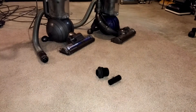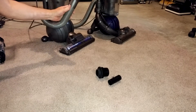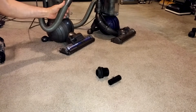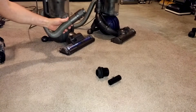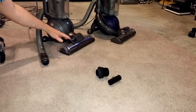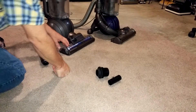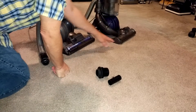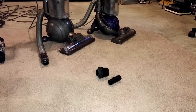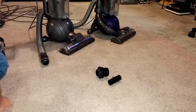The other thing I want to go over is Miko's airflow problem with his DC40 when he's using the hose — just the hose. I've seen your videos and I wonder if we've really addressed the problem with airflow from the hose. From the power nozzle it looks fine. I've got a DC65 here and a DC25 over here. I'm not sure what your changeover valve looks like on a DC40 — I'm guessing it's closer to the DC65, but I'm not sure.